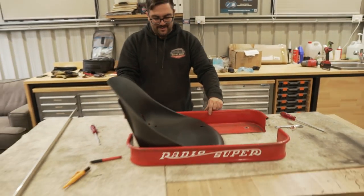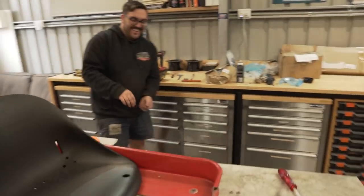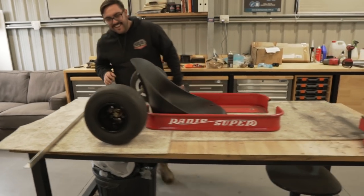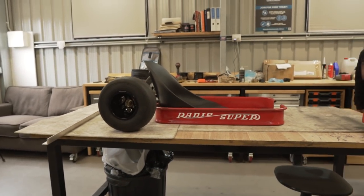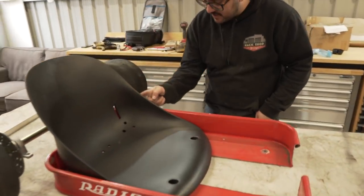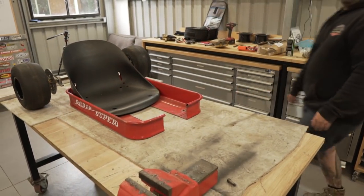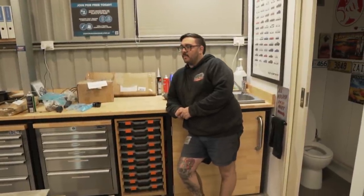Ooh. Chunky. How far out does it come? That's probably what, 125? It needs to come up, obviously. It's going to be deadly because the chain's going to be right here. Unless we run it down to a small cog and then run it forward. Yeah, but we're going to have to come up at least 100 mil, because by the time we put 40 mil of chassis under it and then you want 50 mil of clearance. Oh yeah, 40 mil of chassis.